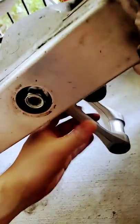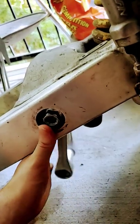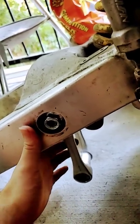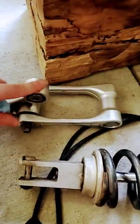Now we're going to take off the 2012 KTM parts — the cushion lever and suspension linkage that I put on the CR500 subframe, or swing arm. Here's what the bolt looks like that comes through. It's got a spacer on the back, a spacer on the front, a washer, and then that's where the cushion lever goes through — that's the KTM one.